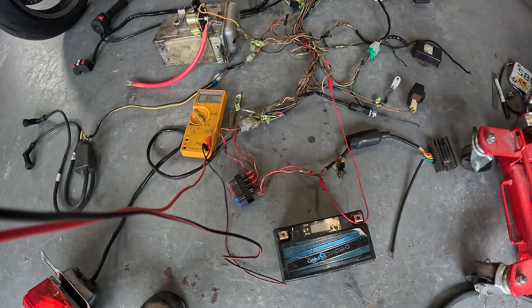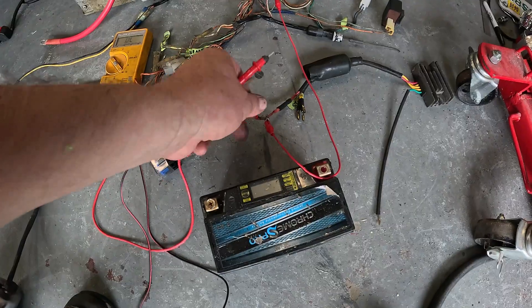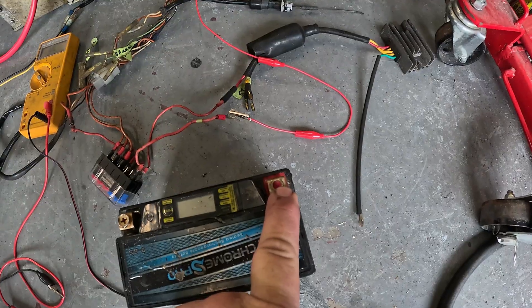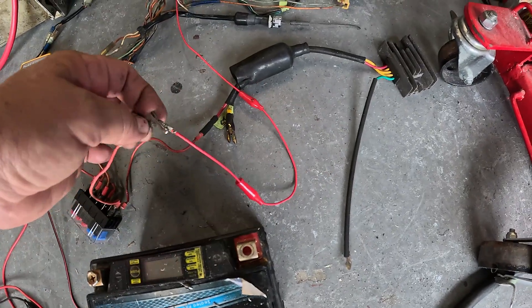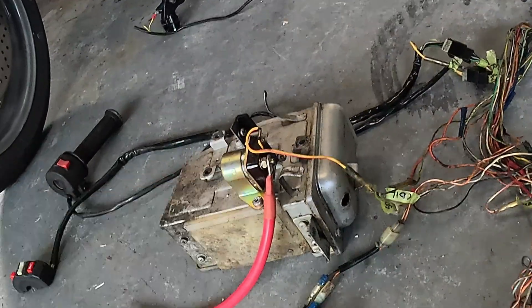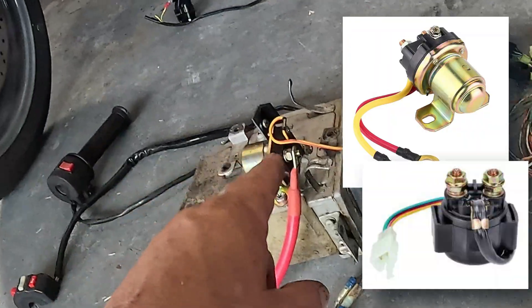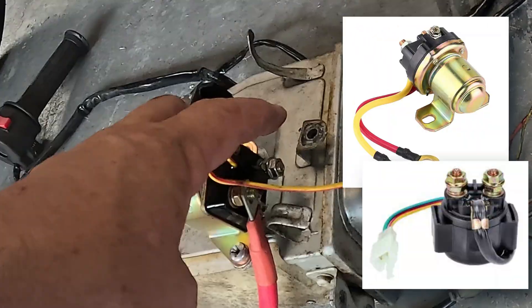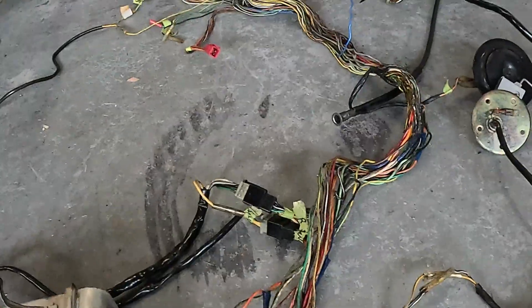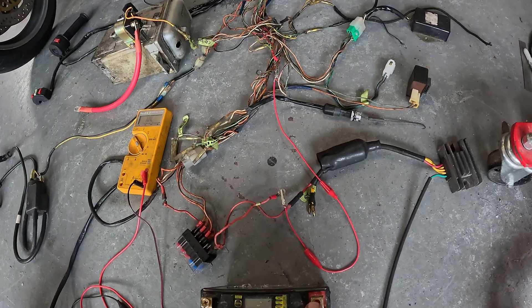Here's the biggest mistake you're going to make: you've got a fuse box and the battery going to the fuse box — to the positive side. So the natural assumption is that's where you hook your 12-volt converter. But it won't work because you're going to remove the starter relay. The battery actually goes to the starter relay, and the starter relay on the same peg shares the same wire that goes to the key switch.